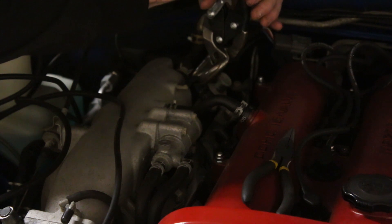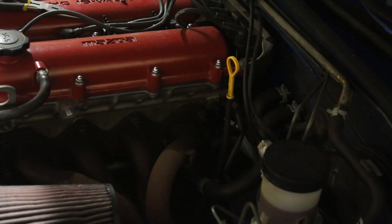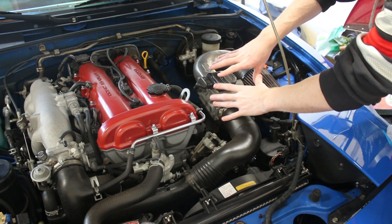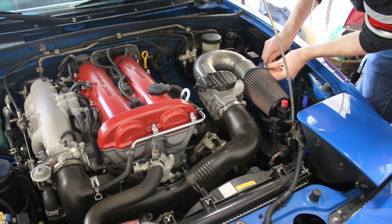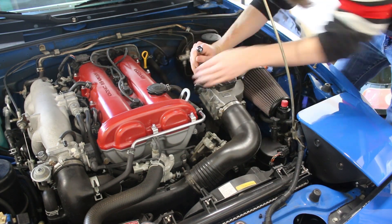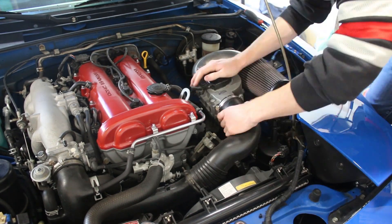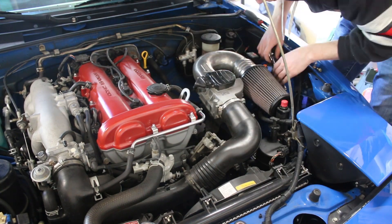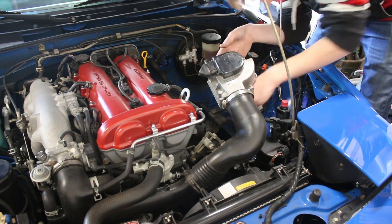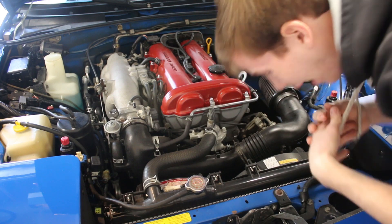This is a very important thing - no cutting on the main line. Just going to cut that right down the middle, a little T here. Put one end on that side - the stock line went like that - and now I've got a T going to this vacuum hose. One of the best things about Mega Squirt is you don't need the airflow meter, so I'm just going to go ahead and unbolt all of it. I'm never going to need it again.